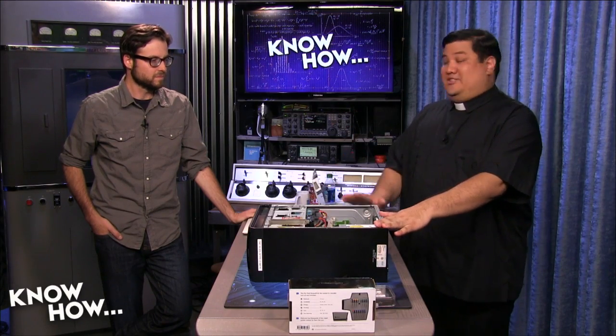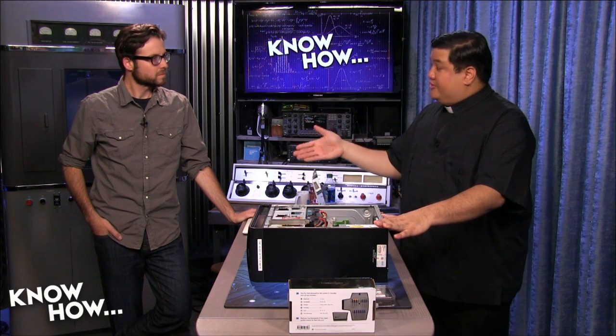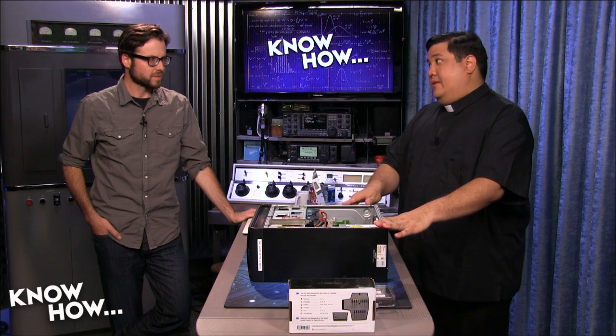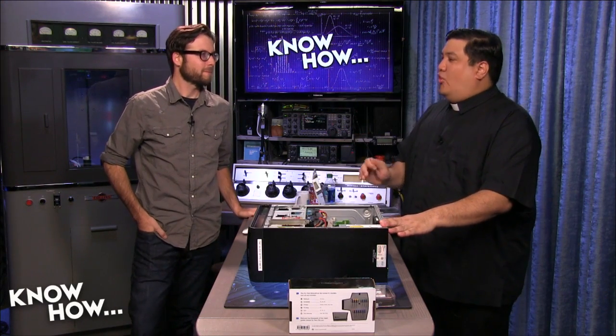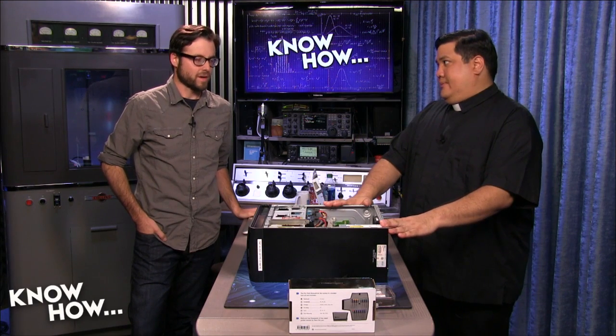The first thing is we care about the CPU. We want a 64-bit CPU because we can address more memory with 64-bit CPUs, so it can't be too old. Because you can't use over, was it 4 gigabytes? 4 gigabytes? Yeah. Oh man, that was a long time ago. That's bad. You also want something with enough horsepower to be able to run the plugins that you're going to install eventually. Right, there are a lot of really cool ones that Patrick and you guys showed off. Yeah, there are some great plugins, but if you recycle that old 386, you're not going to be able to do it.